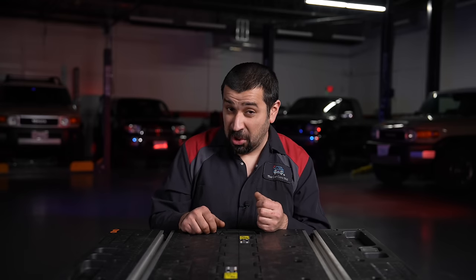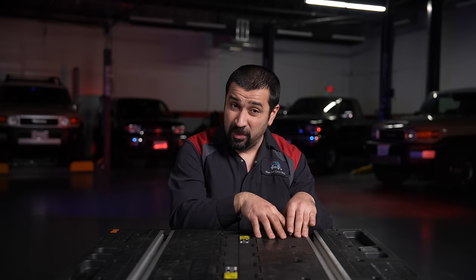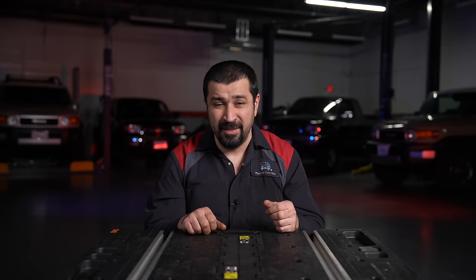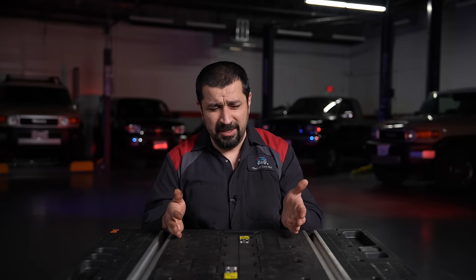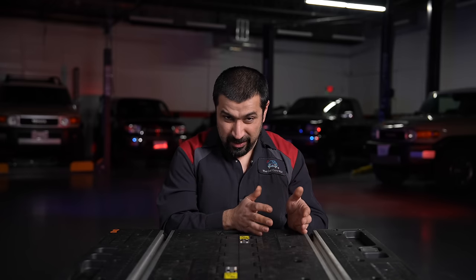Should you align your car before or after replacing tires? The alignment of the car does not change with the tire unless you put on an oversized tire. It doesn't matter whether you get the alignment done when the tire is worn, just before replacement, or after — the alignment should not change, unless you had severely abnormally worn tires. If your tires wore normally and you're at the tire shop, don't automatically get the alignment done; if you want to and need to, fine, but if old tires wore normally you do not need one for the new tires.